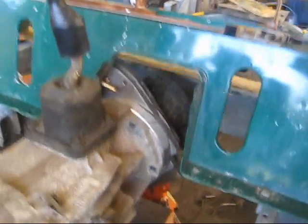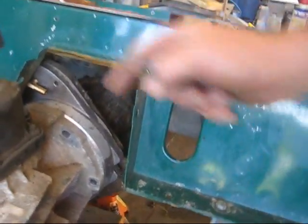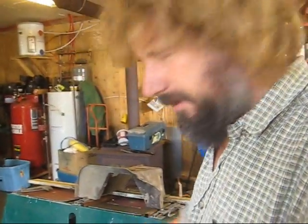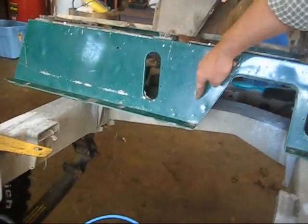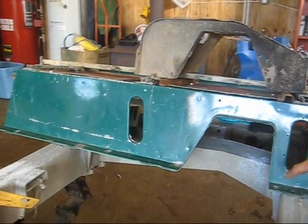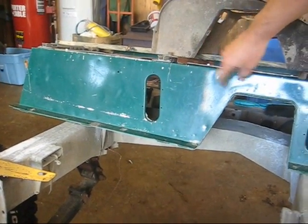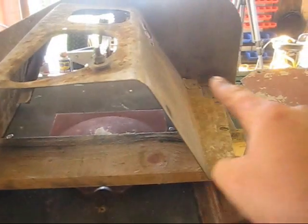This tells a sad tale. This bolt should go in that hole, but the seat box has already been driven over a bit to the left — this is just not going to happen. This opening wants to be about that much wider. Actually I'm not feeling too bad about having to cut the seat box. What I'm going to have to do is extend this over about two and a half inches, which is basically how far the transmission has moved over. I can cut and reform a flange here — vertical with this corner — straight up and over pretty close to two and a half inches. The slope at the back will now come straight over and down.